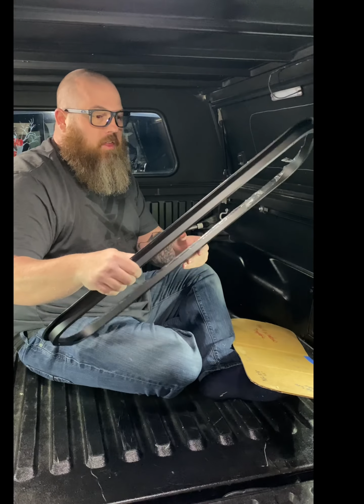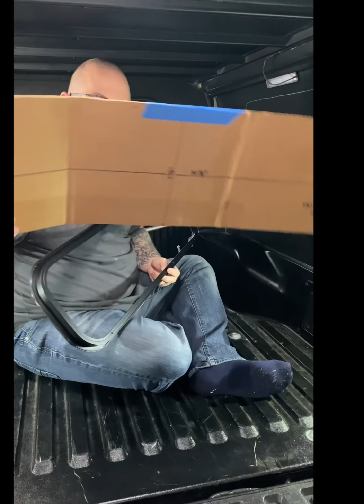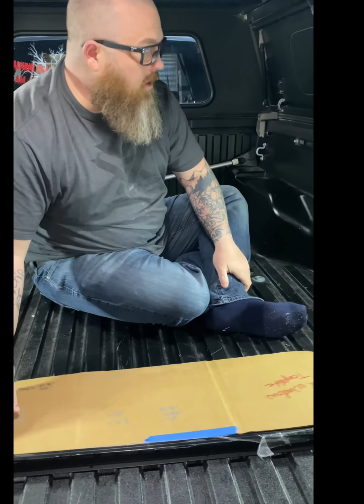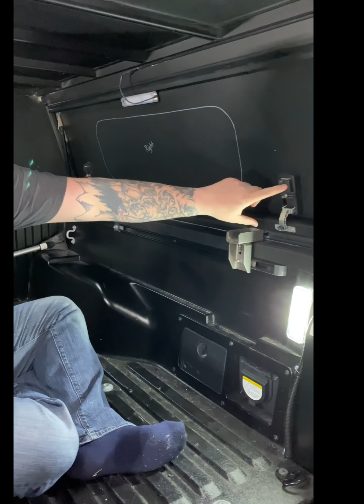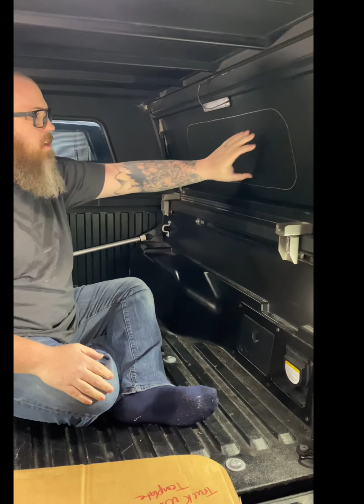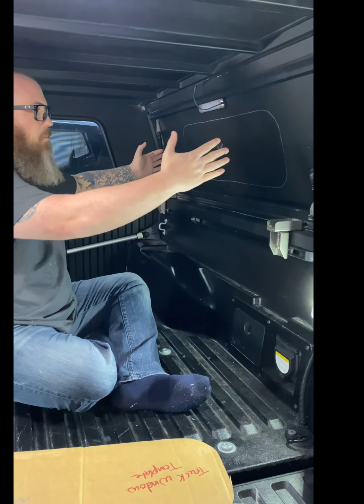And so the first thing they tell you to do is on the outside edge of the frame, you make these like templates, and I made a couple. And then you use the templates to kind of figure out where your window is gonna go. And since these are locks from the outside, in order to center the window, I use the locks as something to center the window in between.